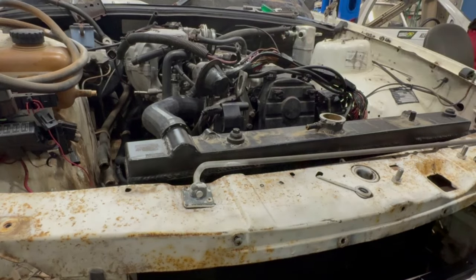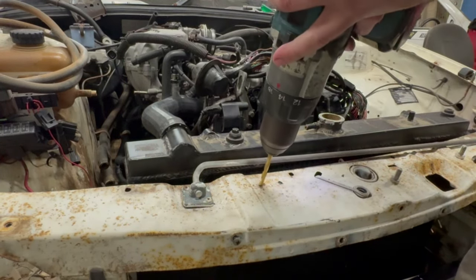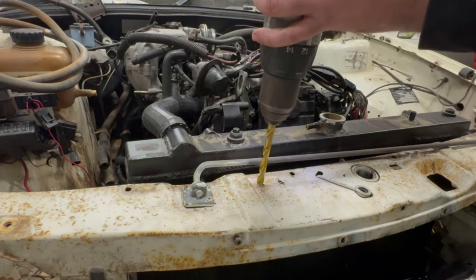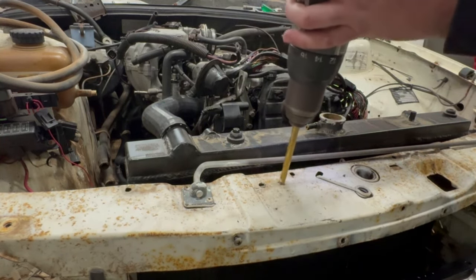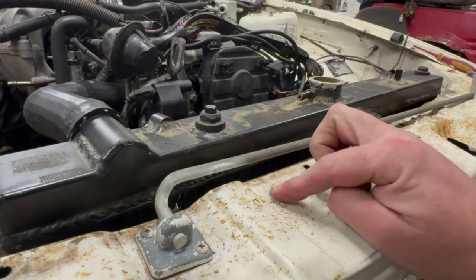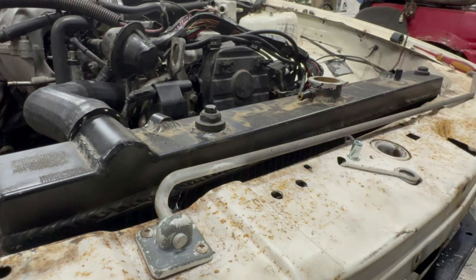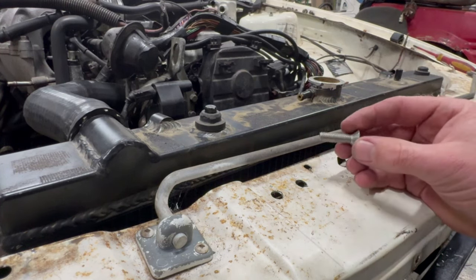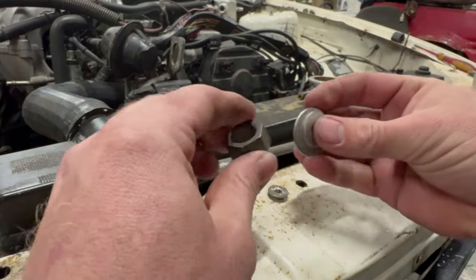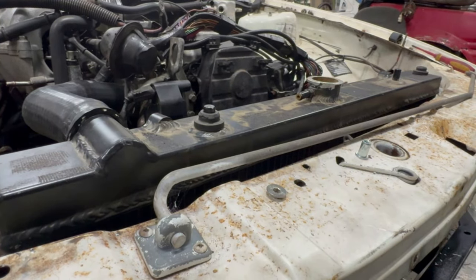That one's getting relocated to the hole saw arbor set when I resharpen it. All right, hole's drilled. I'm going to be a little bit dodgy here. I want to have this nutsert sit flush, and I can't find my little dimple die that normally does this. So I'm going to use this bolt and pull it through with this nut underneath, washers on the bottom like that. Something like that. Let's see if it works.